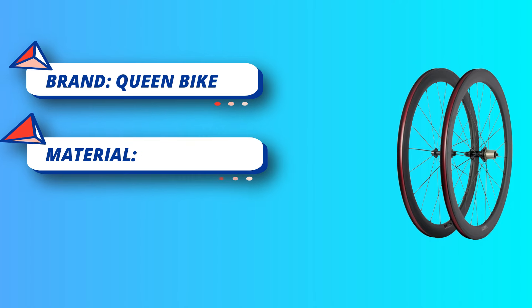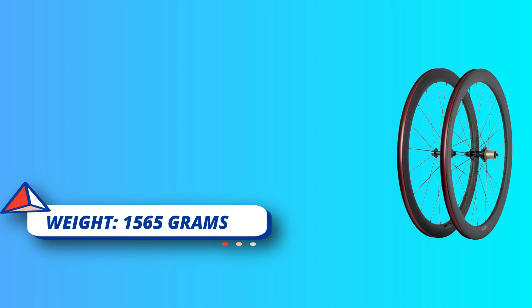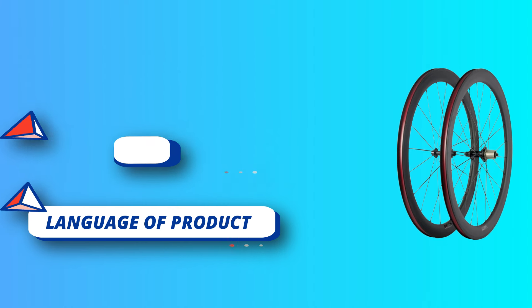Model AR13 black, tight, J-bend. Bearings — Front: 2 sealed bearings, 6800x2. Rear: 4 sealed bearings, 6802x2 and 6902x2. Front hub OLD: 9×100mm, 20 spoke holes.